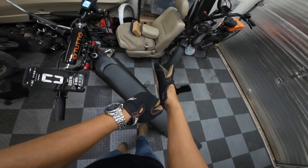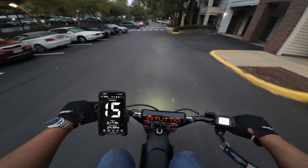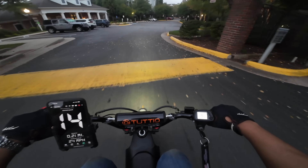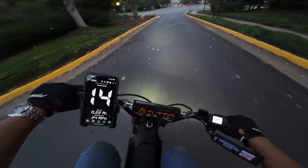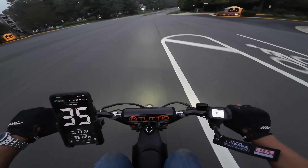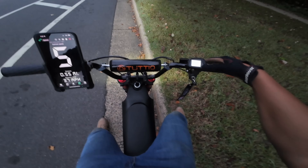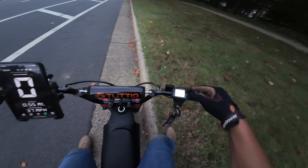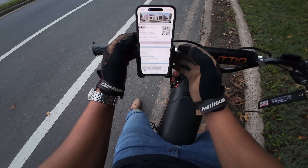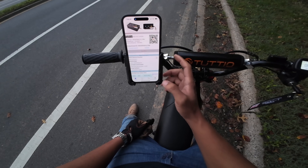Hopefully the stock controller doesn't fry immediately. I definitely need to do something about the chain and sprocket setup — it's still a little bit noisy after putting some miles on it. Somebody recommended I tighten it and add a little bit of tension to the chain, which I'll do when we swap out the sprocket. So what we found out there is in mode 2, when the display is showing 45, we're only going 37. This is definitely not reading correctly. Let's open up the Far Driver app and go full speed on mode 3, 100% power, and see what that does.